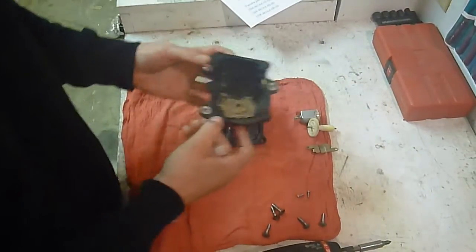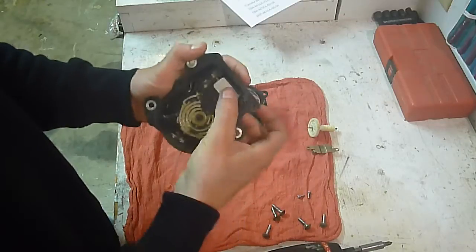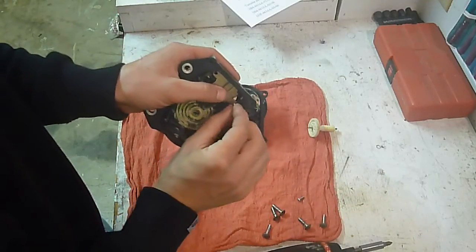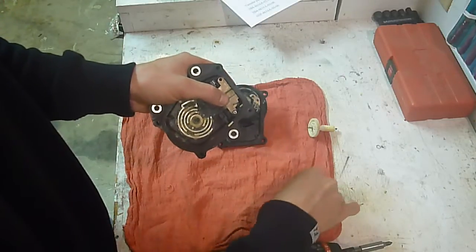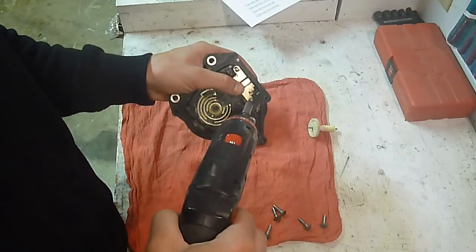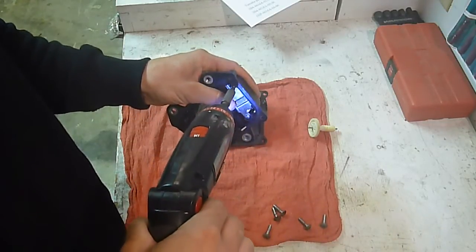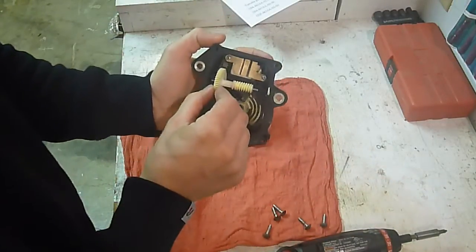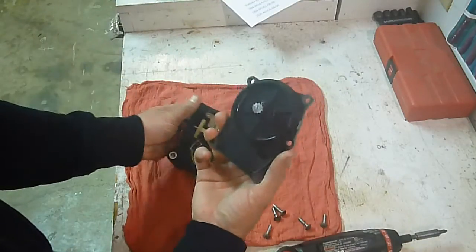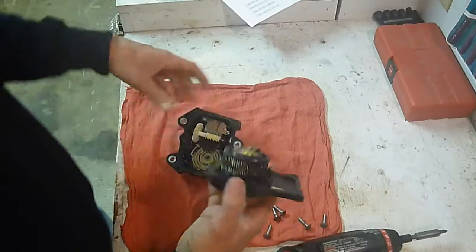To keep that in place, go ahead and put the little motor back in there — slap it in, put the hole down. Stick your gear back in there; it sets in those little slots, that's all it is to it. Check to make sure either your marks are lined up or that flat piece is straight up and down on the ground — that's your two-wheel drive, that's how you want to put it back together.